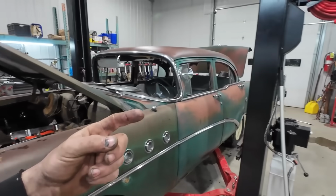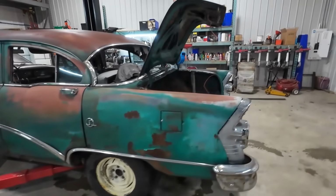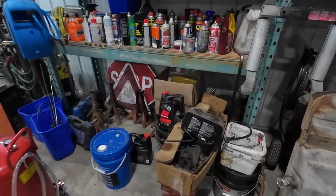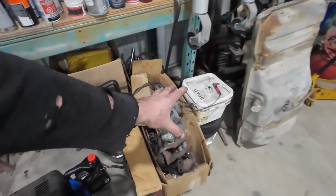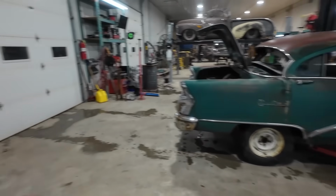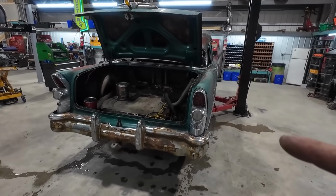Then tomorrow I would like to try to see if we can get that four bar that I had dug out of the shed and see if we can get a differential in the back. I was at a swap meet this spring and I found a universal four bar kit, which I don't really know what it's for, but we're gonna modify it and make it work in the back here. The diff you see me grab before is just a little two wheel drive S10 diff, but should be more than enough for it. It's going to be super narrow, but my plan is that we're going to do wheel adapters and put it back to 5-on-5 so you can keep all of the stock wheels in the car.